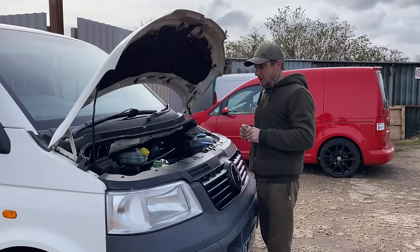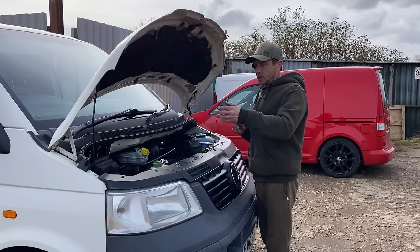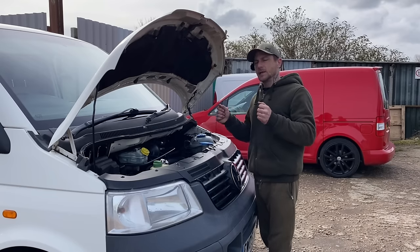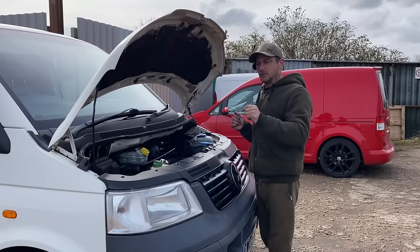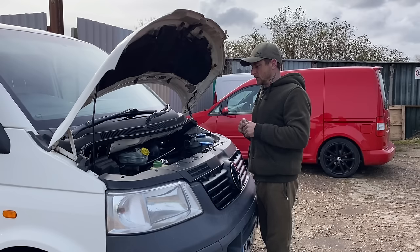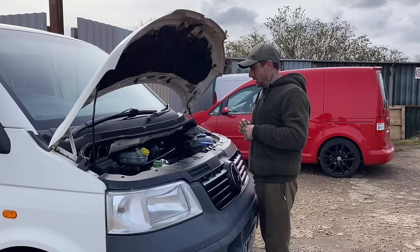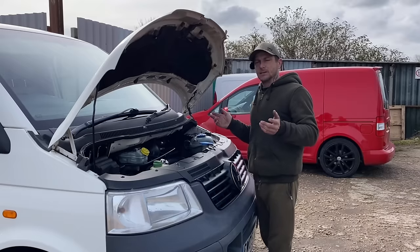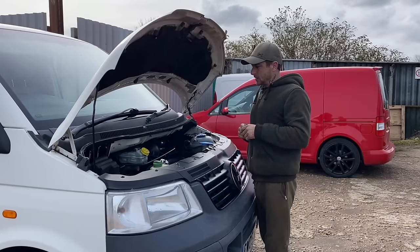I did go over everything while I was there — brakes, tires, lights, all the running gear. Although there was a knocking on the front suspension, with regards to MOT you can have movement in a ball joint — you just can't have a split rubber. A split rubber is a failure; movement in a ball joint or track rod end is just an advisory. I was happy with everything underneath. I also added it to my motor trade policy for my benefit and the safety of others. Hopefully that clears it up.